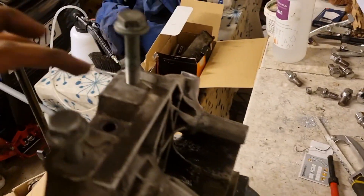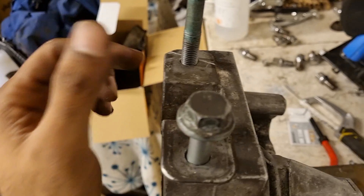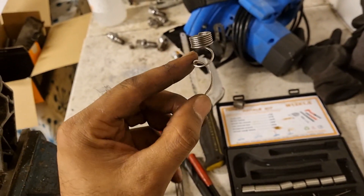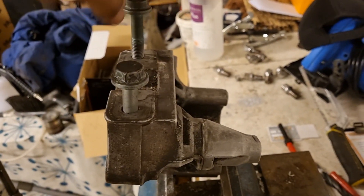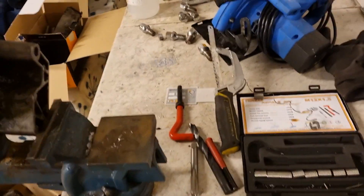This is how you can fix stripped threads on your engine mount — you need a helicoil kit, I'll put the link in the description. Put the first helicoil all the way in, then add the second one, but don't let the threads overlap. I made that mistake and the threads started overlapping and coming out on the inner side, so I had to pull it out carefully without destroying the new threads. I think this works really well and I'm super happy with the result. If you have any questions, write in the comments, subscribe, like, and share — more DIY videos coming!